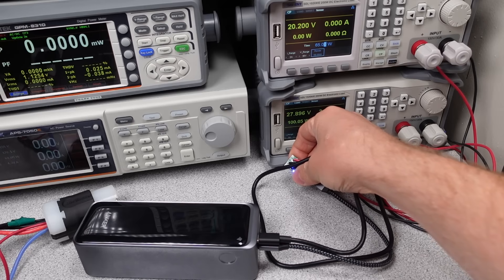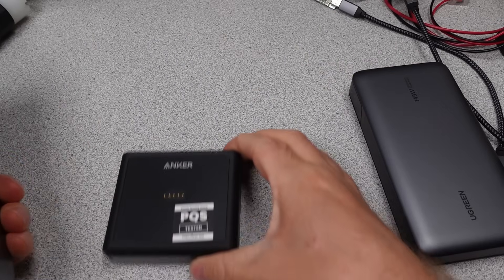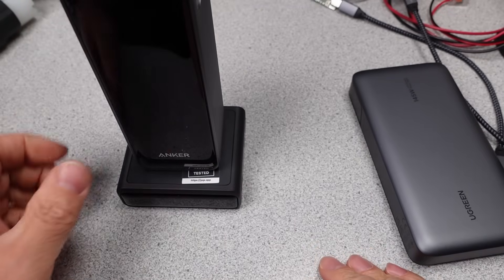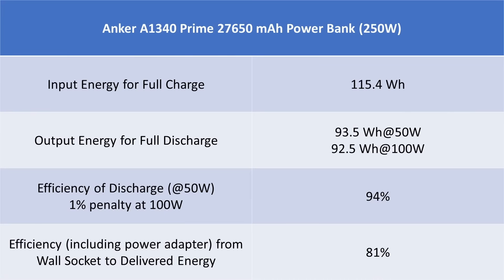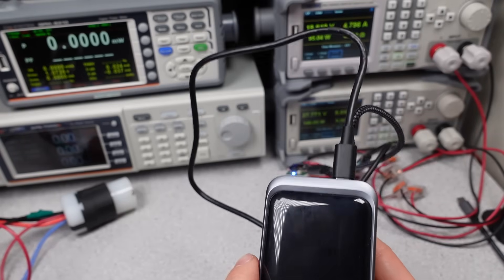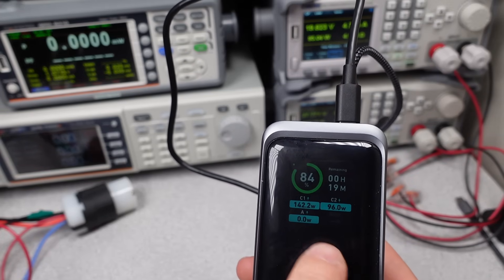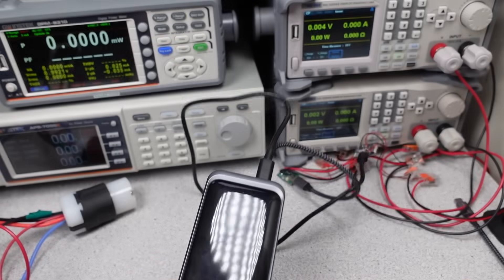This does have Bluetooth and app support — I'm just mentioning it, but based on Anker's history with user data and apps, I'm not going to install it. The Anker does have a multi-pin magnetic connector on the bottom for charging with the base. I kind of wonder if anyone will buy into this system besides reviewers. The power bank was great in terms of efficiency — it matches the ZMI overall, and only loses 19% of power from the wall to provide portable power. Moving on to checking if this power bank can deliver 250 watts: I only got it to 235 watts continuous because the low power mode stays on for hours. Either way, it doesn't do it continuously — it shuts off. I got through a decent amount of the battery, down to about 35%, before it shut down, and it didn't have a persistent overheat warning — it just shut down and reset.